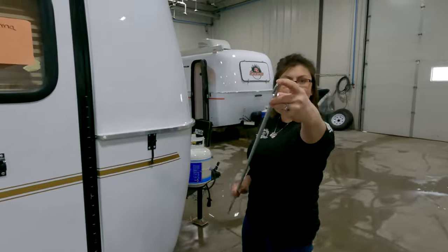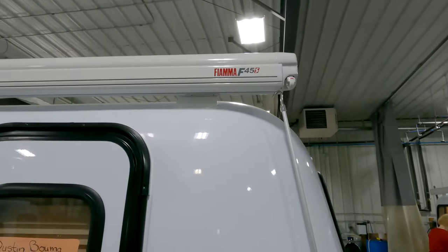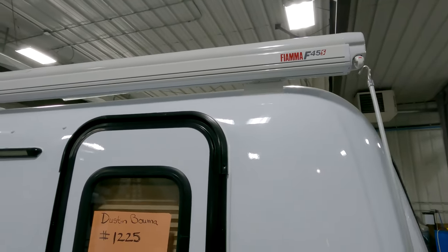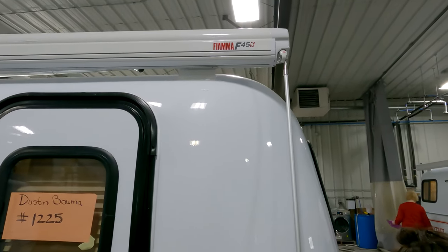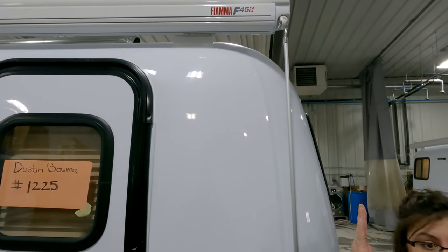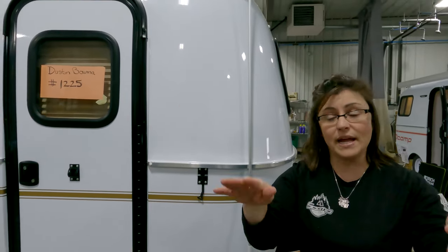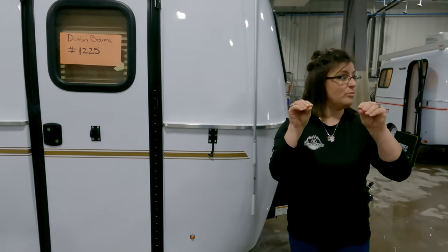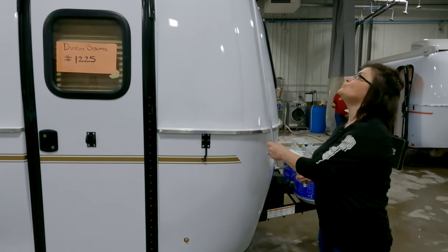Up here you have a red tab. Right now that red tab is sucked up, and you have the same red tab on the other side. When your awning is put away, this is the way you want it to look — both red tabs sucked up. If you put your awning away and one red tab is still hanging down, that means it's not level anymore and you have to reel it all the way back out. Whichever side the red tab is on, grab hold and give it a little pull to that side. Go partway out, pull the red tab, loosen your wing nut, drop it down, and give it a little push up.